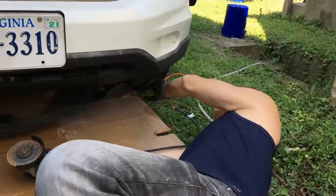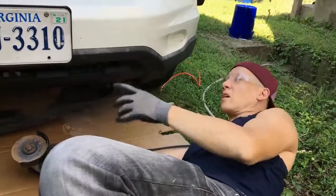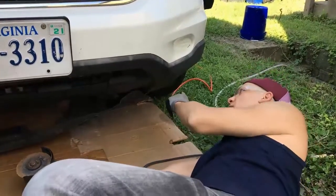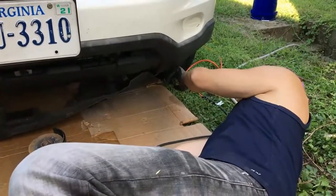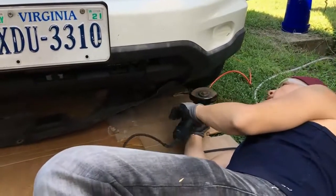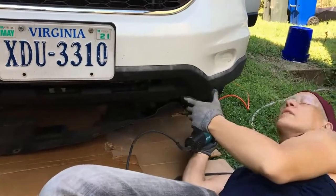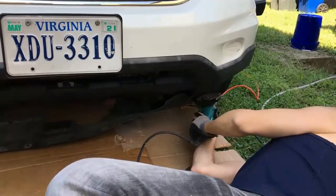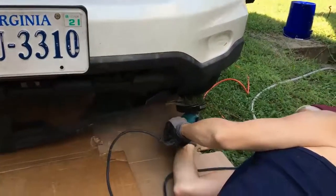This bolt here, normally 10 millimeters, comes off. There's one on either side. The problem is it doesn't come off, and so it's stuck there. It rotates within here. It caught a piece of plastic. It's just poor design. So we're going to cut the head off the bolt. We don't need this extra bolt. We cut it off. Always use safety glasses whenever you're using a metal grinder, and we'll be done with this bolt head forever on this car.